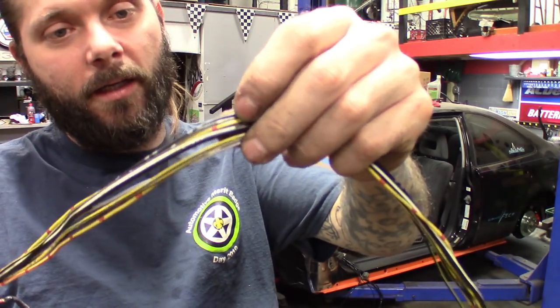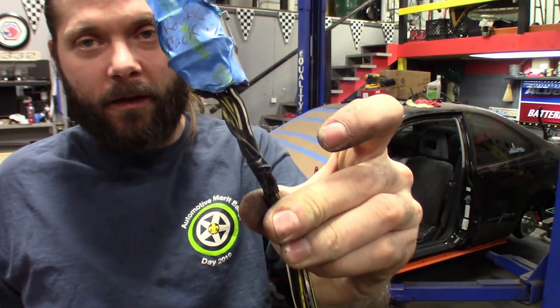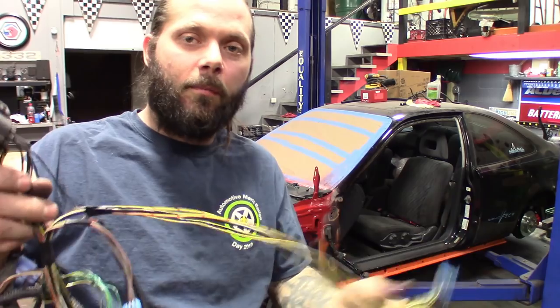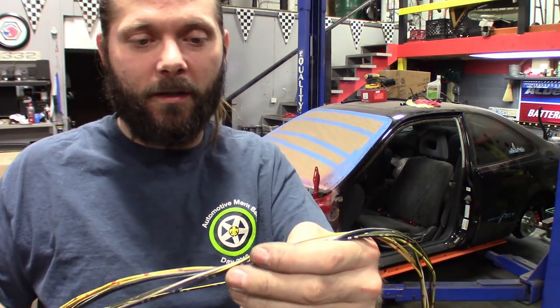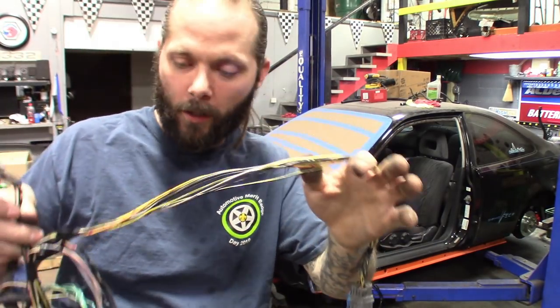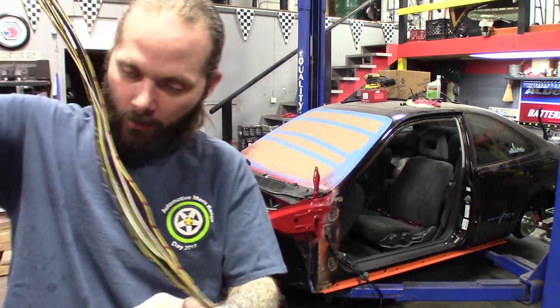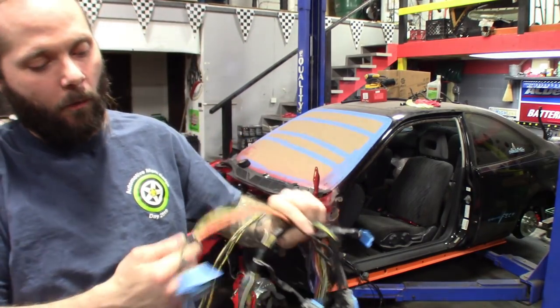I got a few different colors — yellow, black wire, and all that stuff. Keep the gauges simple. I want to make it so the stock colors are on this end of the plug and on the opposite end of the plug, and I'll just lengthen it in the middle. That way, if anybody's ever diagnosing this or I've got to chase a wire, I'll know where the color starts and where the color ends. So basically just keep cutting this stuff back, eliminating what I'm going to eliminate.